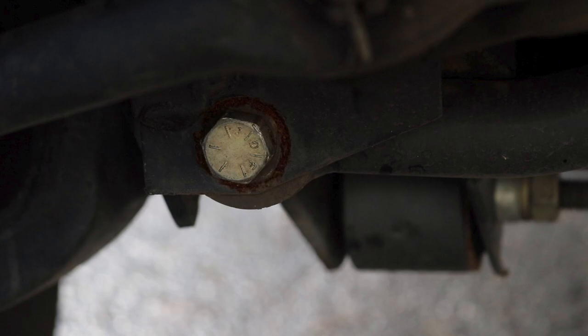There are some pretty easy solutions for it, getting up to more complex ones for some that may enjoy fabricating a little more. Really anything from taking the bolt out and welding a washer on, that would probably be a great option. Or taking the bolt out again and drilling out the hole. Now this one involves you having to get a new flag nut, a regular nut too.